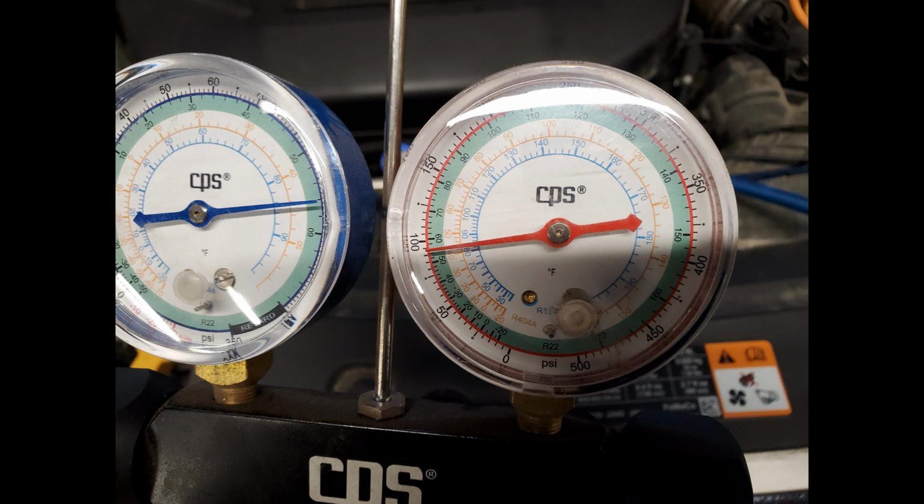So to recap where we're at, at this point we've determined that the compressor is being commanded correctly and that we either have no flow or no restriction. Now our experience when it comes to expansion valves that are stuck open for whatever reason is if you can get enough refrigerant flowing through the system, you can get a slight pressure imbalance between the high side and the low side. That's clearly not happening here, even though the compressor is commanded pretty much to the full flow position. Therefore, our conclusion on this one is that the compressor isn't really pumping refrigerant. That's the reason for the no change in pressure across the expansion valve.